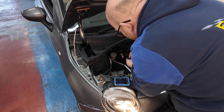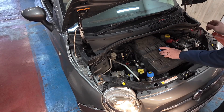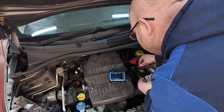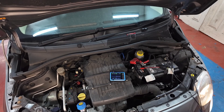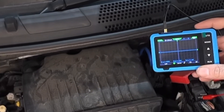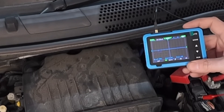So let's remove that, go straight onto the battery and to here. Now you can see - getting a good signal down it now, perfect. So we've got an iffy wire somewhere. We just need to trace that through and see what we can find.